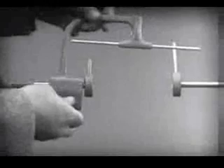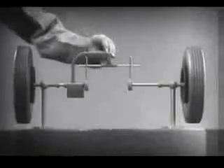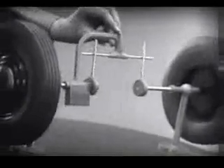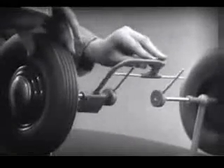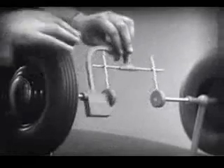Let's get something to hold this bar in place so that it will press against the spokes. Notice that this support is not locked to the axle — it turns freely. Now we can spin the wheels by rotating the support. This is fine as long as both wheels are able to turn at the same speed. But when we go around a corner, with this arrangement we cannot drive one wheel faster than the other, and if we stop one wheel, the other wheel won't budge.